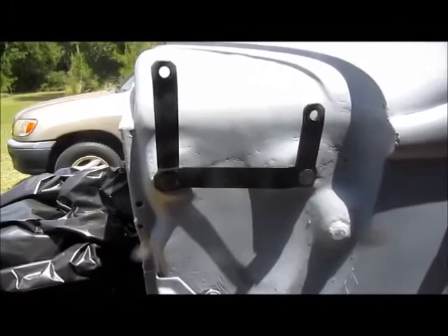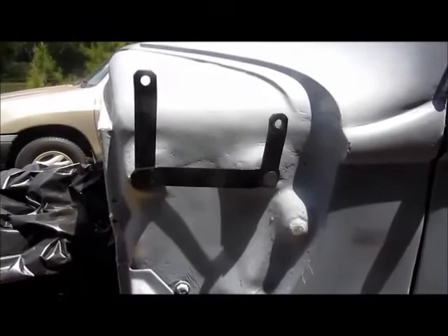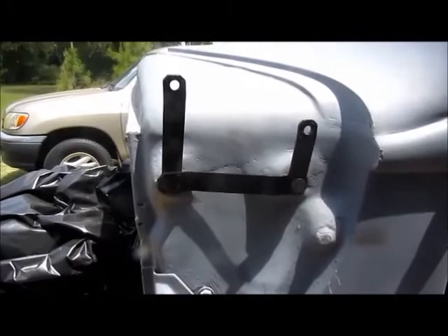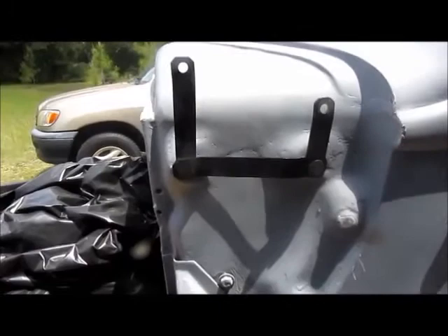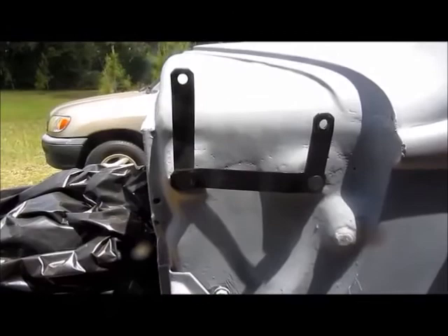Here we are out in the bright sunlight. This is how the hinge attaches to the hood — where it attaches to the cowl. You can see it's the top two holes that are in the cowl. Then you would go inside of the truck and be able to get to the nuts on the other side of this hinge that would allow you to adjust the hood to fit better on the cowl. I sure hope this helped, because I was getting frustrated — I couldn't find any pictures or videos that talked about how to attach these hinges and what they look like and how they fit. So I hope this helps. Thanks.